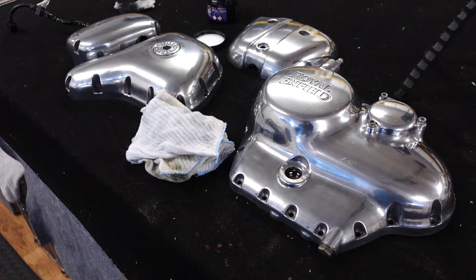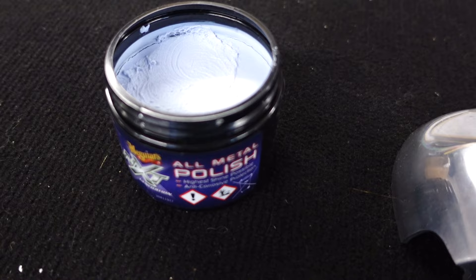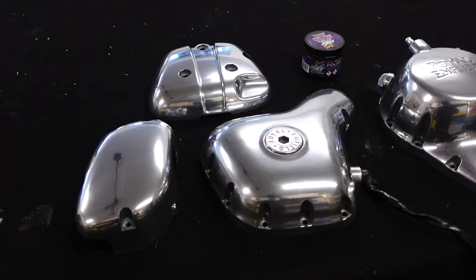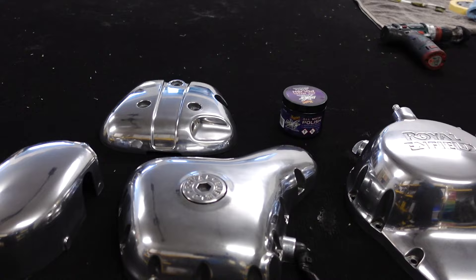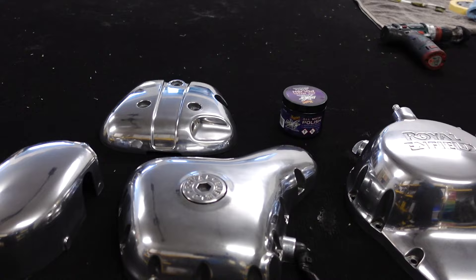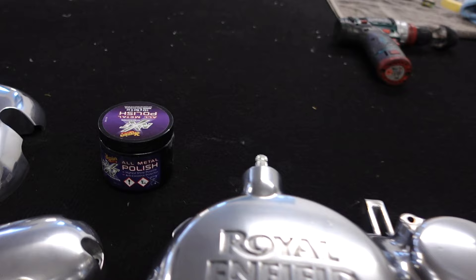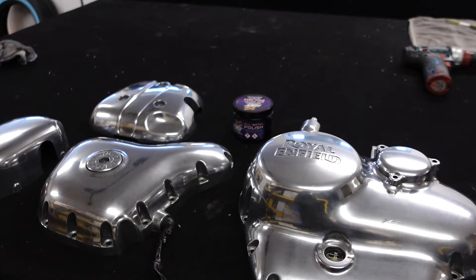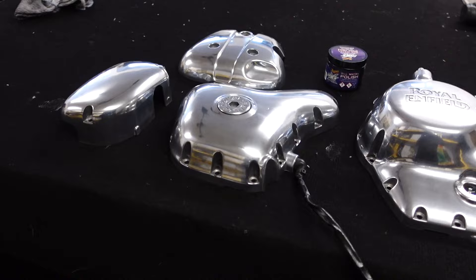I'll go over it all with that and get it up a level - you can see how that bit is much shinier now. I think I'm done - that came out really well. Wish I'd waited for that polish to arrive before I did all the stuff with the Autosol, because that probably would have saved me a day of messing around trying to chase a finish that simply wasn't possible - the polish was just too coarse. Good for chrome and really hard metals, but not best for alloy. Meguiar's NXT. And I'm not sponsored by them - it's not product placement, I would never do that to you. It really is good stuff and I paid for it properly.